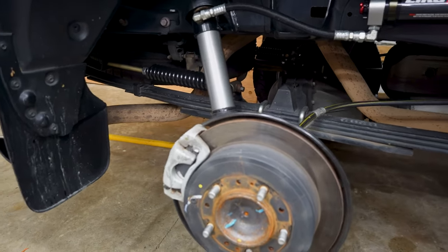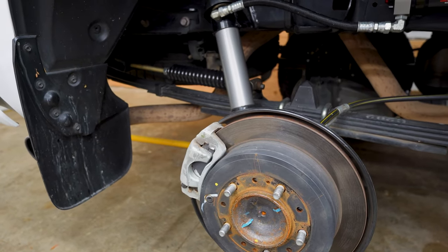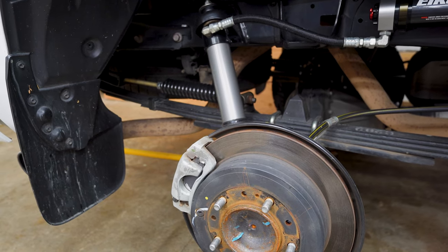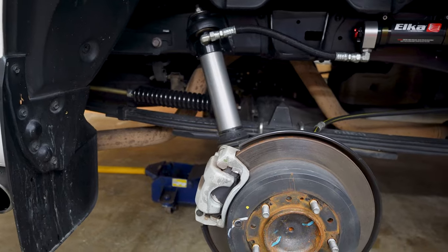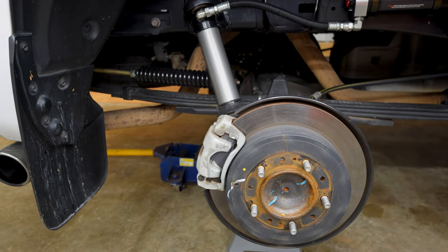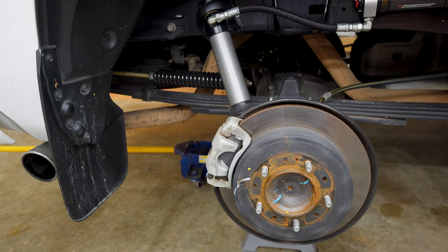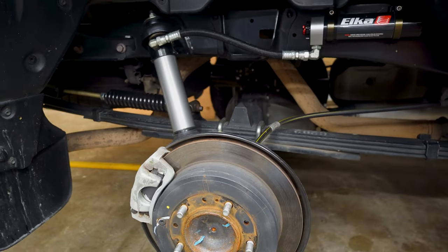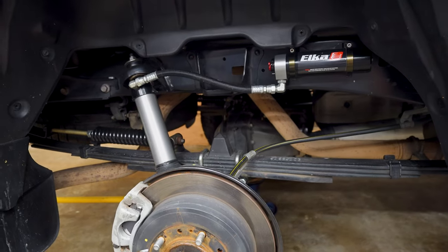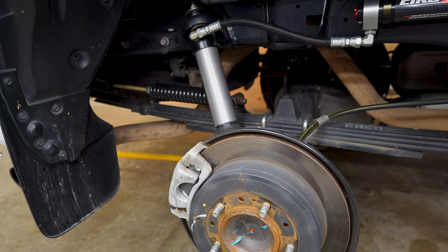If you reference back to my earlier videos, the Tundra towing video did not have the RAS kit on it, so you can see how it sat then. The Anderson hitch video does have the RAS kit, so you can see the difference in where it sits. I also adjusted the hitch height and done other things, but it's definitely a noticeable difference in how it tows and handles the load with the RAS kit - it's more stable, doesn't wallow around. The Tundra actually towed quite well before; the only issue was sag in the back. The Anderson hitch also leaves something to be desired for distributing weight back to the front axle compared to more traditional setups, so the RAS kit supplements that quite well.